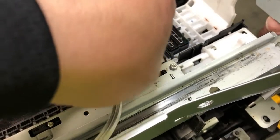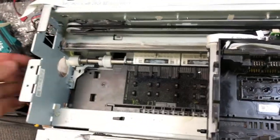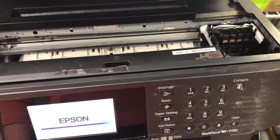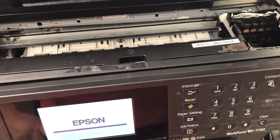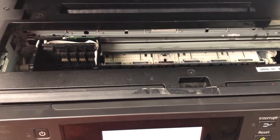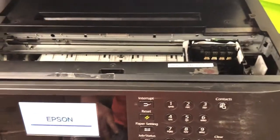Now you can get a pair of scissors and cut and remove the rubber band. Let's check the white lever: if you rotate the disc counterclockwise, the white lever should stay down; if you rotate it clockwise, the white lever should go up. I also checked the printed carriage — now you can see it can go all the way to the right. After putting all the screws back, we can give it a test. The printer is going to spend some time on the right to figure out position zero and then move all the way to the left. Here is where we had a problem before. I hope you enjoyed this video — visit us at www.bchtechnology.com or locally at Greensboro, North Carolina. Cheers.